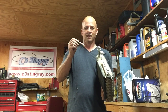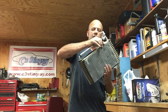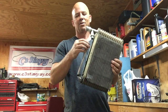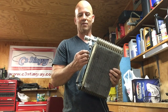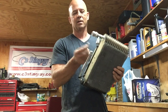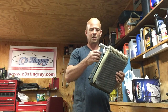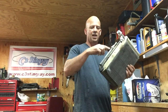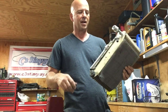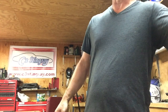this thing, because it's always clogged up, especially if you've got an old used evaporator. You want to replace that. The old ones in there are going to be stuck if they've been in there for a while. Every time I've tried to yank one out, it's got these little knobs on there you're supposed to grab and yank them out with, but it hardly ever works. They always rip in half. I found if you take a propane torch and heat it up a little bit and then pull on it, they'll pop right out. It loosens them up. Save you a little time and money trying. Once they break, they're a bear to get out of there.